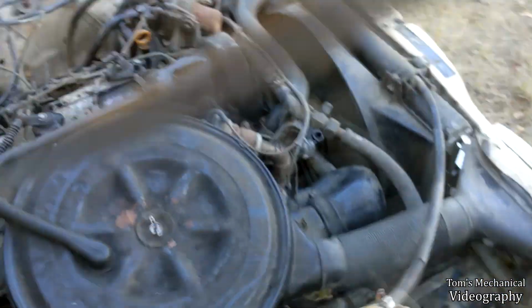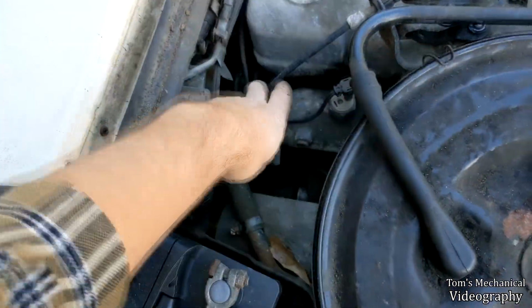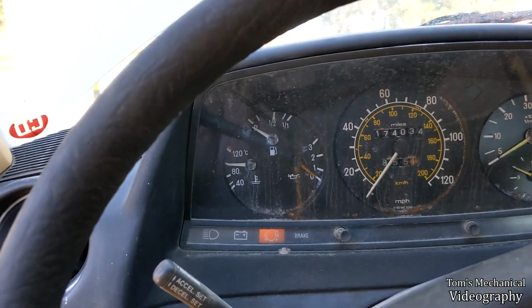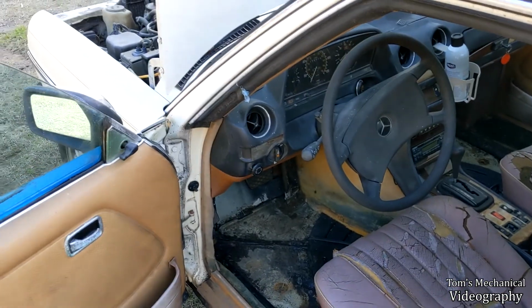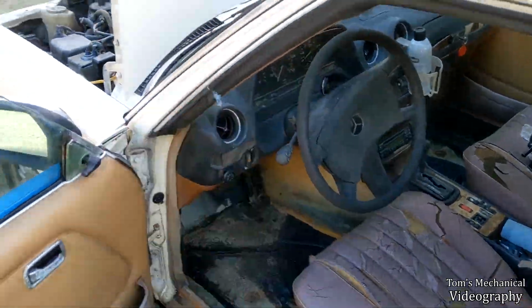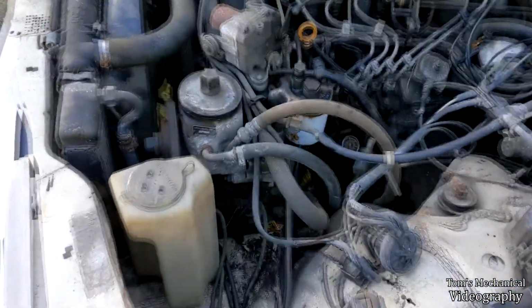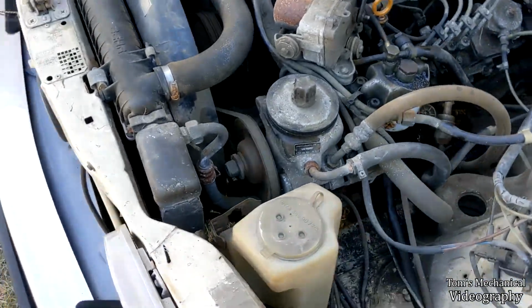So I'm going to shove this bad boy back in here and see if we're overheating or not. I have a theory that it won't overheat if it's in park. And I think I'm correct, because I've been sitting there and it's still at like 98. So I think I can explain that amount of not overheating by just crud in the cooling system and the shitty, terrible radiator. This is still making that weird noise, and it's now spilling like power steering fluid out somehow.